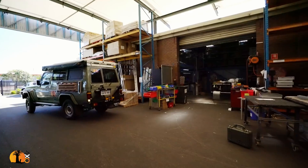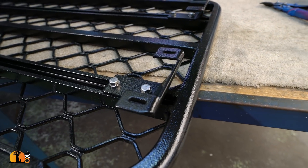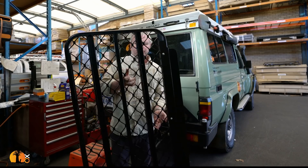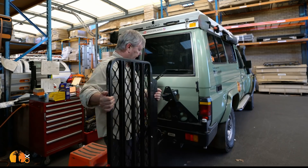Many modern SUVs are not suitable for carrying more than about 100 kilograms. In my case, I'm fitting it on top of the Hercules rooftop tent, which has mounts sufficient for a lot of weight, but I don't want to overload it - the vehicle is already a little heavy. So I have to be wise about the weight of the rack itself and what load I'm going to put up there. I'm putting it there principally for firewood and as a secondary place to carry a spare wheel. The Geiser Track Lander very kindly made up a rack for me - it is 10 kilos, which I'm very happy about. I'm also going to attach a ladder for easier access.